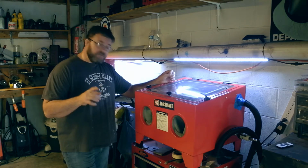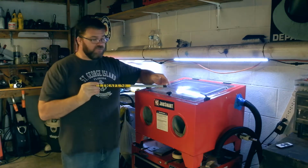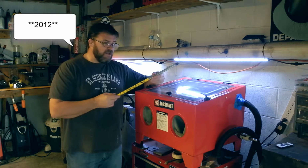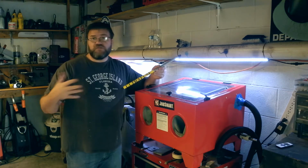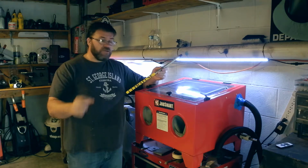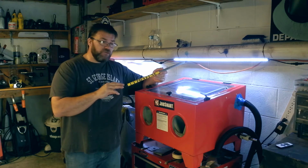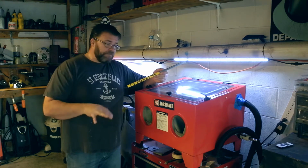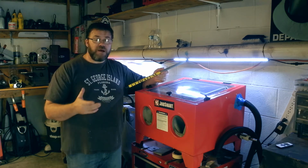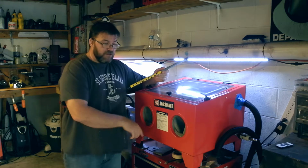I bet you guys haven't seen that stuff. Now I used this on my 2002 WRX, where I did a water to air intercooler setup, and of course used aluminum piping and an aluminum heat exchanger. I needed to attach the recirculating valve fitting to the aluminum intercooler piping. I don't know if it's like brazing, but I was able to braze the blow-off valve fitting, or bypass valve fitting, to the aluminum piping. So I might be able to use this to do the legs because I'm going to make this freestanding.